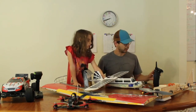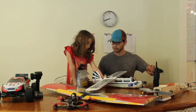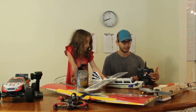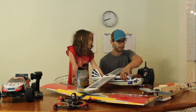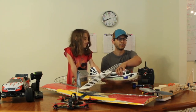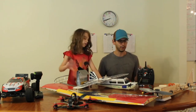That sounded okay — maybe the battery's running down a bit. Let's check the ailerons — ailerons are working good. Elevator is working good, so we did it right. On these radios: aileron is left-right, elevator is up-down, and rudder is this way. The rudder is good. We flip the engine cutoff switch, pulse the throttle a little bit — we've got thrust. This aircraft is absurdly overpowered and super light, with a thrust-to-weight ratio of about 1.5.